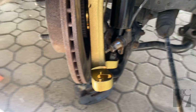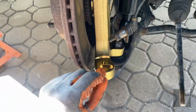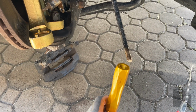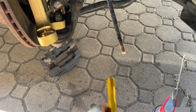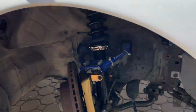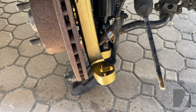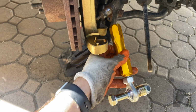And I did run into an issue. So Part Shop Max actually mentions on their website that if you want to run their knuckles, you would have to run their outer tie rods. So they recommended to buy these, but now these don't thread onto the inner tie rod. So I don't know, I'm gonna reach out to them and see, but this kind of screwed me up. I guess I'm gonna just bolt the factory outer tie rod to here for now. I'm not gonna drive the car, it's just gonna be parked in the driveway, but I do have to move it back to fit everything inside the driveway and be able to close the gates. So I guess I'm gonna put this back on, take some pictures, send it off to Part Shop Max and see exactly what's going on. I don't know if I need different inner tie rods, or if I ordered the wrong outer tie rod.